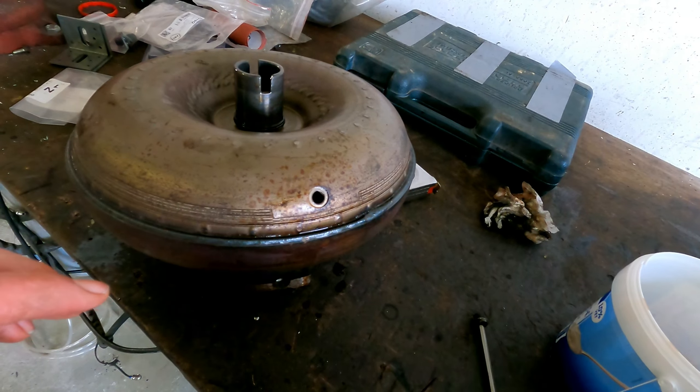It's really handy to use the drain plug because you can do it underneath the car. On older cars, through the two holes in the bellhousing you'll see that bolt, and just with an Allen key you can remove it, drain it — that will save you a lot of mess. Later on when you start it, the pump will just pump the oil back in. This gear is connected to the oil pump, and this is just the gear section.